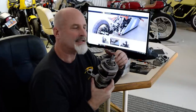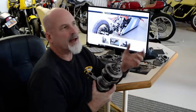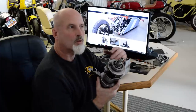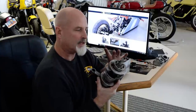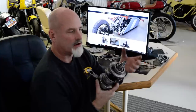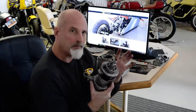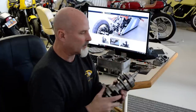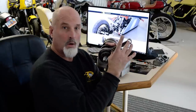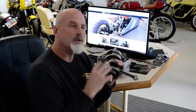It was kind of a panic getting it all back together, and it was never right after that. It's about time to remake the crankshafts. I made the crankshafts — as you've seen in the two-stroke world thread — because they needed to fit in the RZ case, which is a little bit smaller than the RD 400, but have the RD stroke of 62 millimeters, because I know that port timing works right. I made three sets of connecting rods with a 120 millimeter center-to-center rod distance, and it's time to remake them.